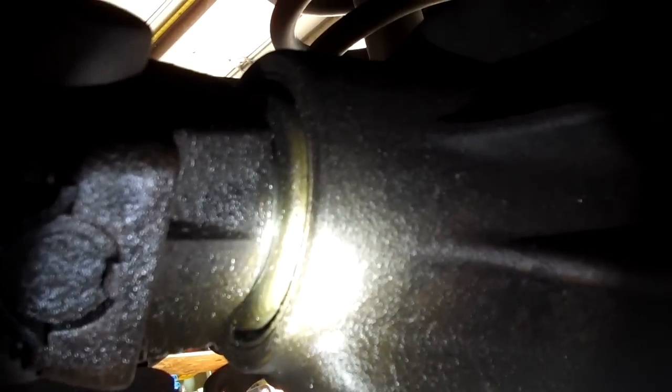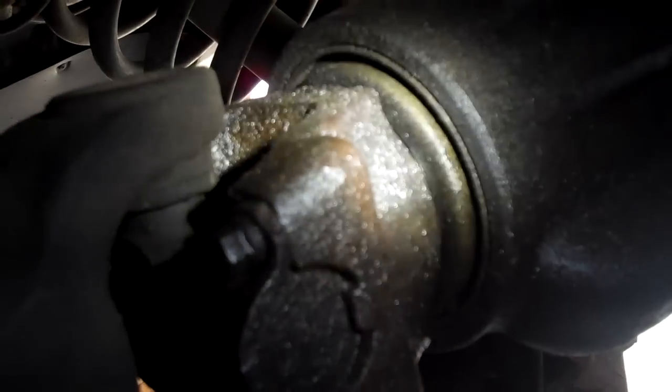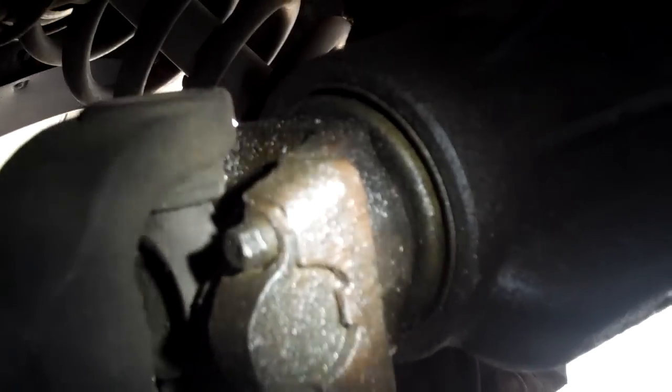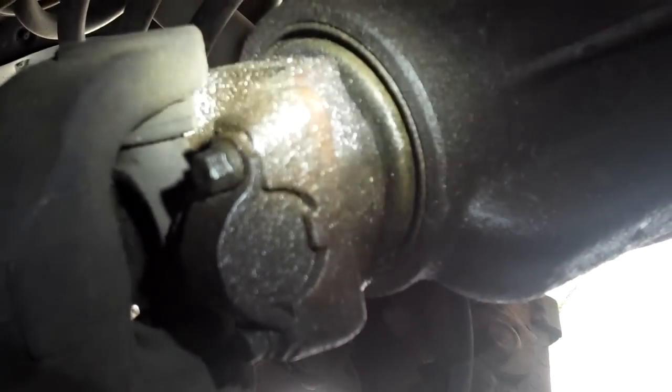Inside here is the pinion — not like rack and pinion, but ring and pinion, like a ring gear. This is the ring gear; you can see the bolts on one side. They call it a ring gear because when you unbolt it, it just looks like a ring. The teeth are good and everything else is good, but this bearing is toast and it keeps eating seals. When I go to use it for a rescue in the snow, it just makes it smell really bad and you can tell it's getting hot. So we're tearing it down and putting a new one in.